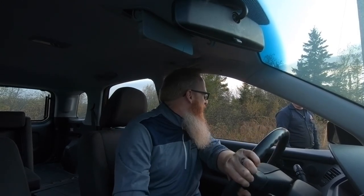There she is — that wheel is turned to the right ever so slightly. This one is a little more than slight — who needs an alignment? I've got the booster pack and the keys; we're going to see if it'll start and move under its own power. She starts! I've got to remember she's got no brakes either — I tore off the brake line on this side. We're going to see if we can get over to the shop under its own power. I can use the handbrake. She's making noises — the wheel is right up against the fender. And we've got to remember that control arm's not completely in there yet either.